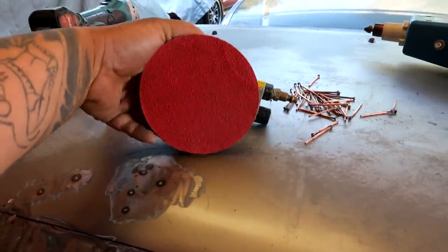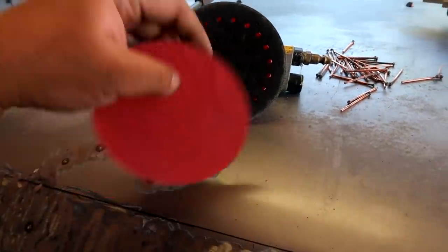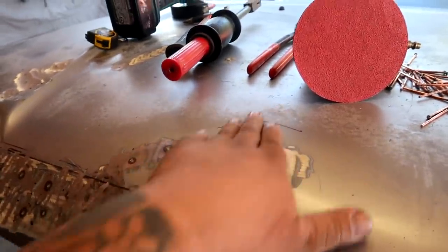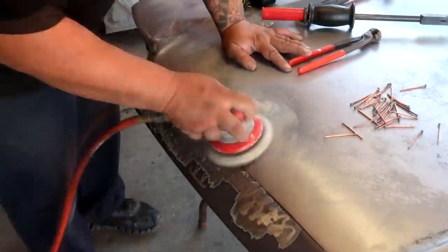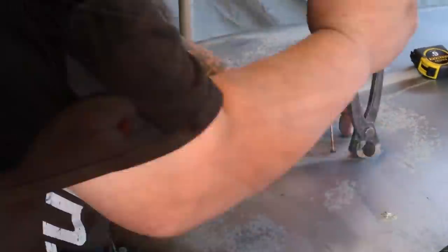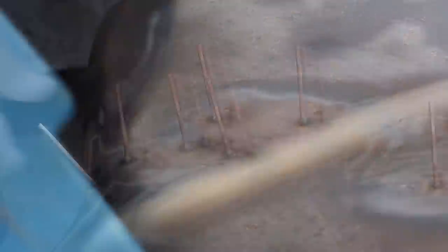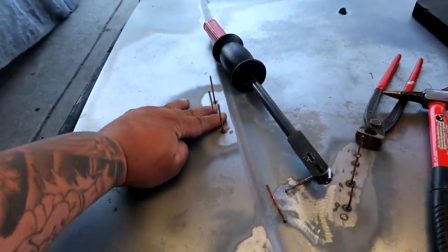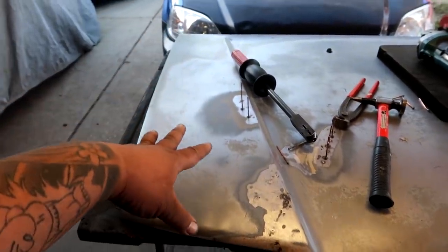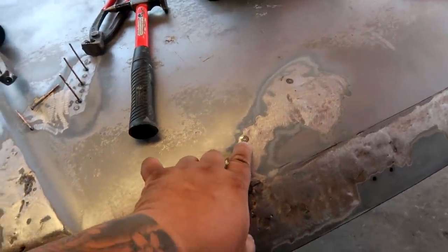I said earlier I didn't have any deep sandpaper, but I found this in my drawer — it's a sticky type but I think it'll work just fine. I'm going to sand all of this down to bare metal and try to feather out the paint so I don't feel this layer right here. I've become more and more impressed the more these dents pop out. Every wagon owner knows there's always this dent right here on the passenger hood — not sure what causes it or if it's a manufacturer defect, but I got it pulled out. Everything feels really nice and straight other than the high spot of the stud itself.